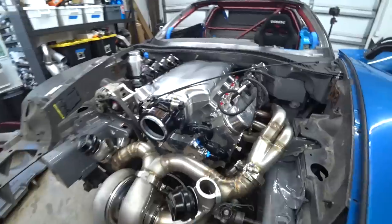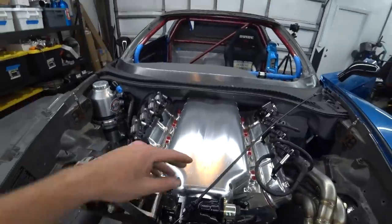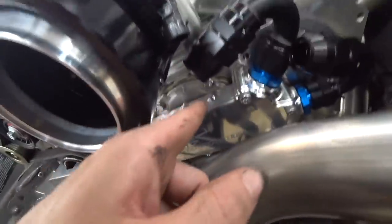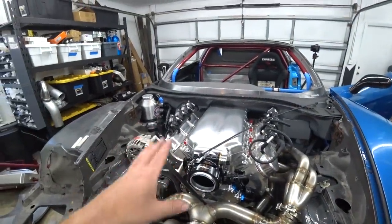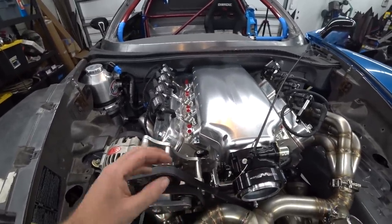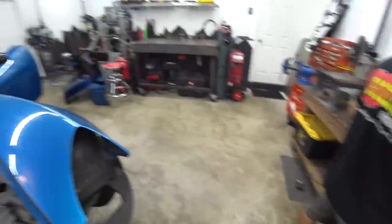Josue is installing the Earl's steam vent kit — a really nice, clockable unit. We're going to tie all four steam ports together and route them into our water pump plate, which already has a 1/8 MPT port. This is very important on an LS — you have to tie the steam vents together and at minimum run the front tube. Do not block them off or the car will overheat. People try all sorts of tricks with steam vents on LS engines, but this is just critical.